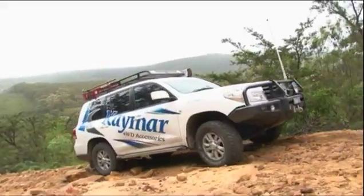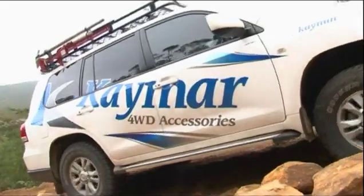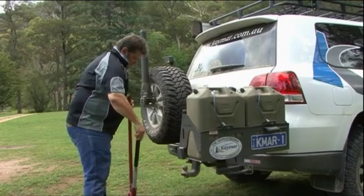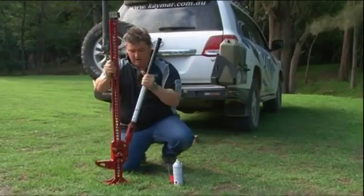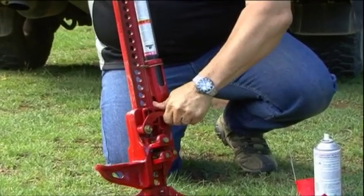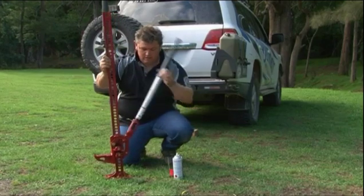We've got our high lift down off the car. The beauty about being on the car is that it's neat, tidy, and out of the way. The problem is it's always open to the elements, so a few times every year when you use your high lift jack you may find it very sticky. You want a smooth action, so give it a quick spray, then pull it up and down, making sure to lock the jack in and give it a couple of clicks with no load on it.